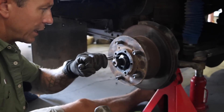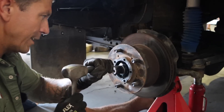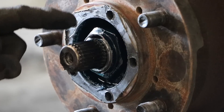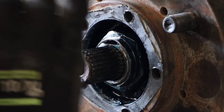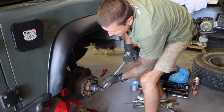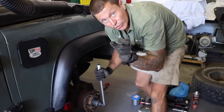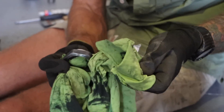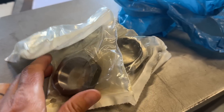I have to remove the lock nut. These nuts have an anti-rotation tab so I've got to knock that out nice and gently. Try to make sure you get it opened up as much as you can because if you don't get it back to a nice circle and you back off the lock nut, you can damage your stub axle thread. This is a later model Land Rover Defender with the newer style bearings — the bearings are torqued against a spacer tube to 210 Newton meters, that's why it takes a bit to break it out. The lock nut I'll throw in the bin; it's in perfect condition and I have reused them in the past when I haven't had one on hand, but I bought four brand new ones.